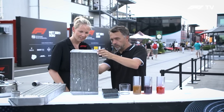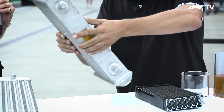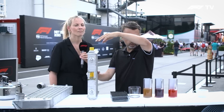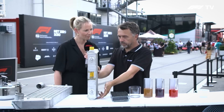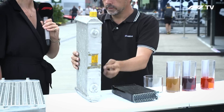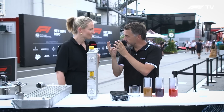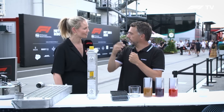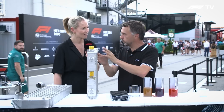Like a snake — because the air passes through this way. This sits on the side of the sidepod. And then we put the water, we put the oil, we put the hydraulic liquid on this inlet and outlet of the radiator, and all the air going through will take the temperature from the oil and from the liquid we want to cool down and put it into the air — transferring the temperature from the liquid to the air.